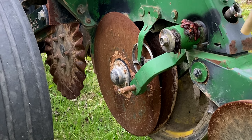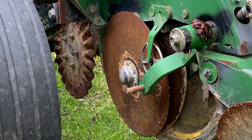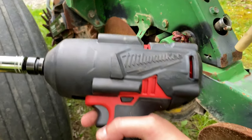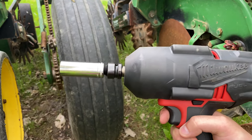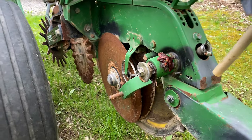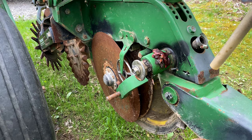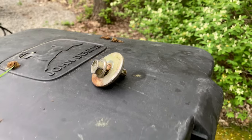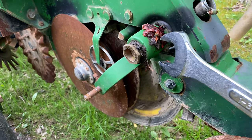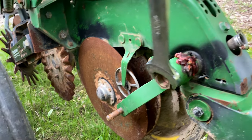You unbolt it — there's a rubber tire around the outside. I had a 3/8 breaker bar on here and it wouldn't break loose, but the Milwaukee big gun — I know I'm using the wrong type of socket, I got it reduced down to the 3/8 drive — broke it loose on the third setting, so there's a lot of foot-pounds going on there. This bolt is 18 millimeter on the head and it holds the retaining arm on. It's an inch and three-eighths.